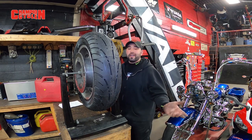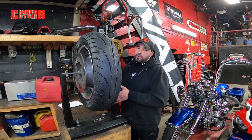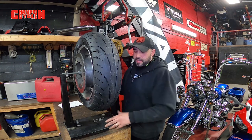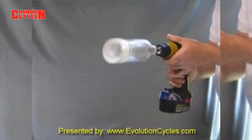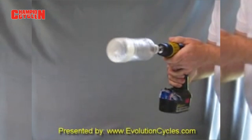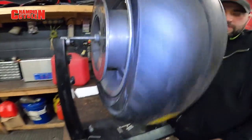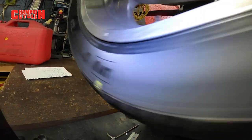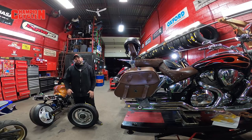What this is proving is that the balancing beads will always go to the heavier spot. With static balancing they'll always go to the bottom because gravity is gravity. These counterbalancing beads are meant to balance via dynamic balancing — meaning when the wheel is rolling and you're riding down the road. Take a listen and you can actually hear the balancing beads chugging along in the wheel.